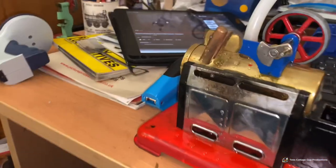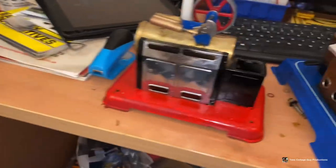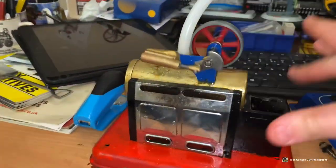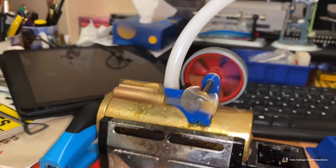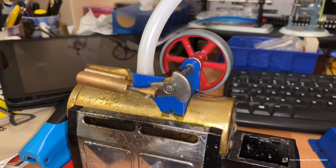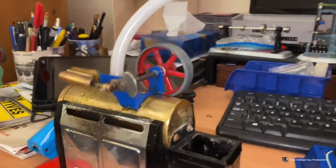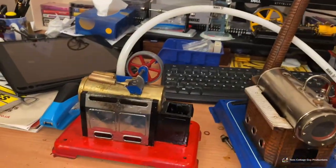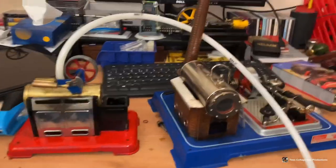There we are - see how water keeps coming out? So now the boiler is completely empty. If it doesn't work this time, it's not going to work, so let's go. It's not happy, but it's working. MAMOD SP2 on compressed air! We'll have to look into that, because that ain't happy on compressed air and it should be, well, relatively happy.